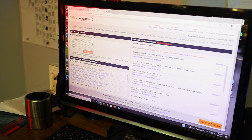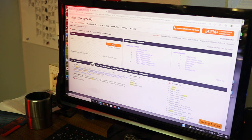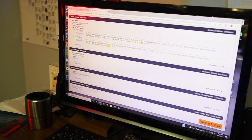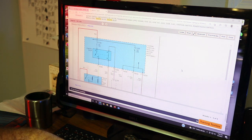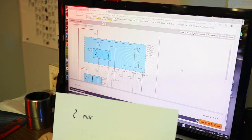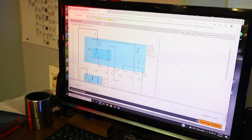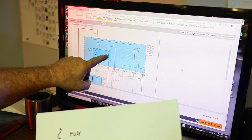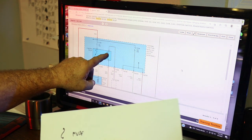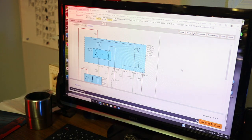We go into color wiring diagrams, starting circuit. You can see this wiggly line — that's a fuse. Every diagram, no matter what the manufacturer, that's going to be a fuse in a 12-volt system. The line with the bumps in it is a magnetic coil — that's what you see in the relay. A magnetic coil requires positive and ground to magnetize it. Once it's magnetized, it pulls the circuit closed in the relay so that the starter works. These little V shapes are connectors — showing you there's a connector in the circuit, a male and female connector.